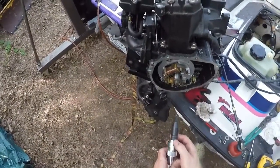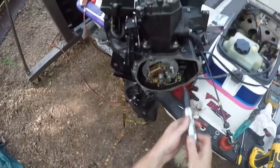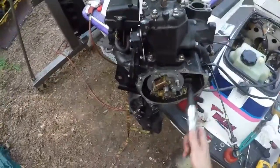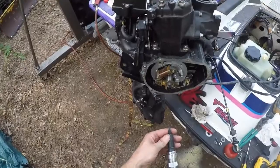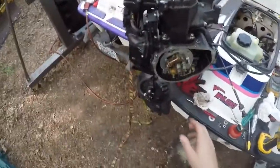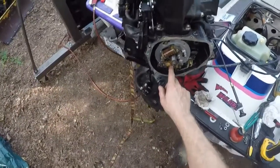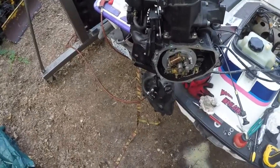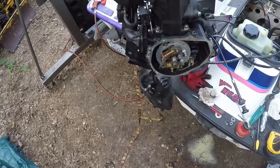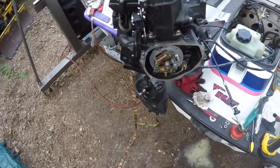You set it to right or left - the handle goes to the left, you push it down - left is counterclockwise to loosen. It worked: I hit it a couple of times, loosened it up when it was about to strip, and now I can get it out. Really handy tool. On this machine I believe this is the lighting coil or charge coil for the battery, and this is the CDI coil which is showing high resistance - around 24 megaohms - up at the other end of the wiring system, which I don't think is correct.